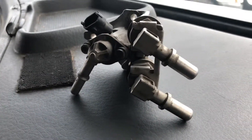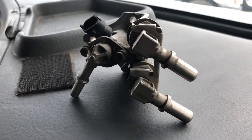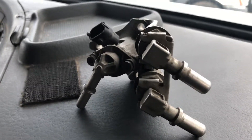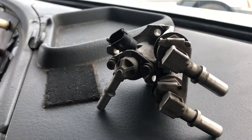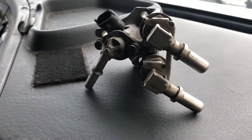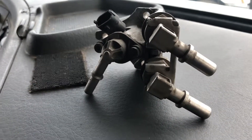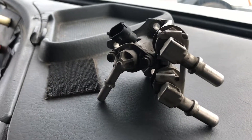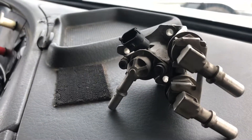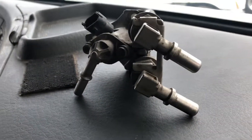The newer one-box design is better than the older designs. For me, Volvo has one of the best designs for the DPF and SCR because they're all on the right-hand side on the lower part of the passenger door — not complicated. The SCR has no sensors at all, just a plain box with a NOx outlet sensor after it.